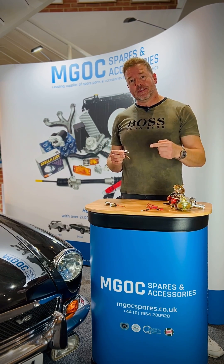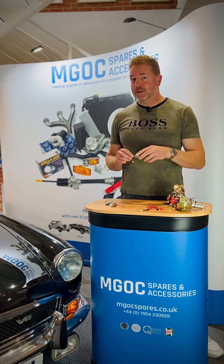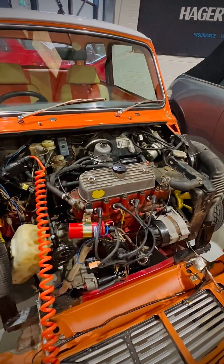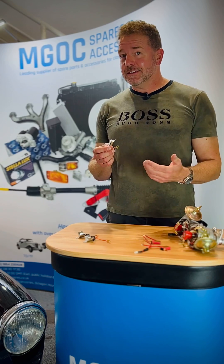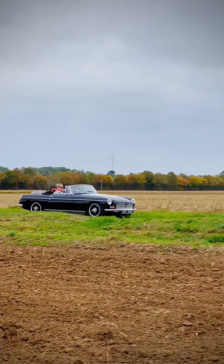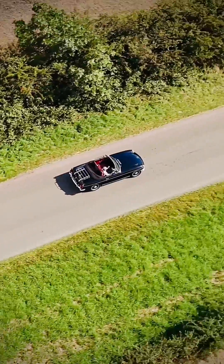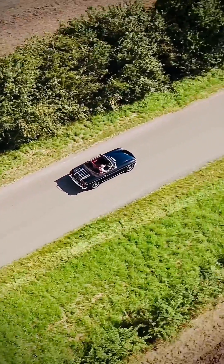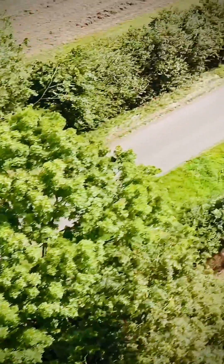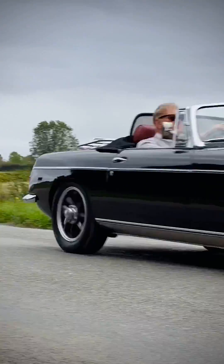The problem is because of the way they're put together and built, they can fail — and that's you coming home on a recovery truck. So first we need to understand what the condenser actually does. It's a capacitor, which means it holds on to charge and then releases it when it's needed. It's basically there to suppress the unused spark from the points during the firing cycle, and they handle a lot of amps. When they're not working, the points will open and close but the condenser won't be able to release that spark — and that's you coming home on a flatbed.